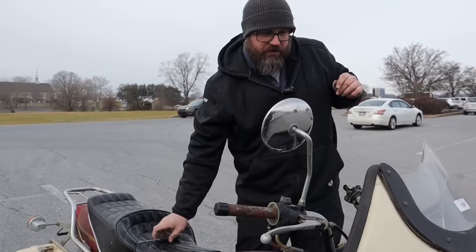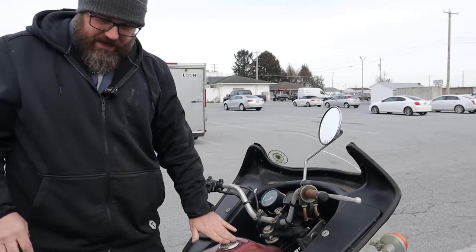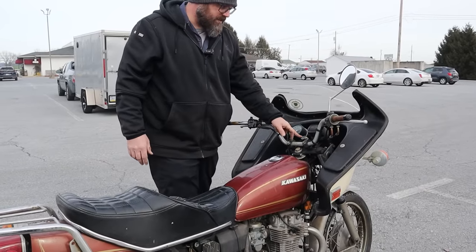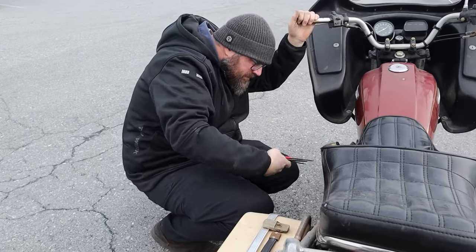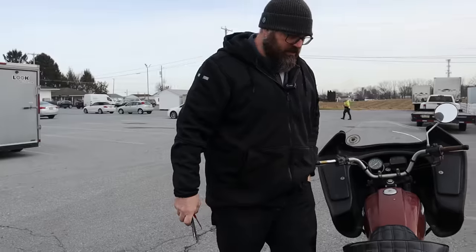Right. Okay, good news is I found the harness here. I think we can jump that key switch. Bad news is I still can't get into the gas tank or lift the seat. But that's okay. Let's just take this one step at a time. First thing we need to do is bypass this. Looks like I have some area there. Worst case is I can get some starting fluid in there, see what happens. Worst case being if you can't get the seat off? Yeah. Let's jump that switch.